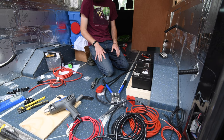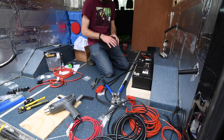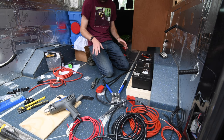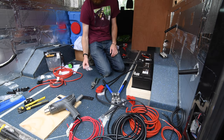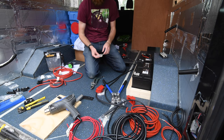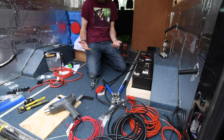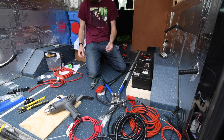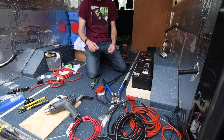It's really important when you get to the electrics stage of your build to try and order everything beforehand. There's a lot to order and things take time to come. You've got to have terminals for 16mm and 25mm cable, and for M6, M8, and M10 bolts. I found it really useful to plan out my electrical diagram first and then work out all the wire thicknesses and bolt sizes from that.